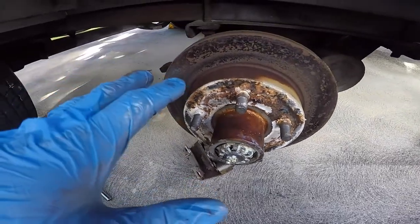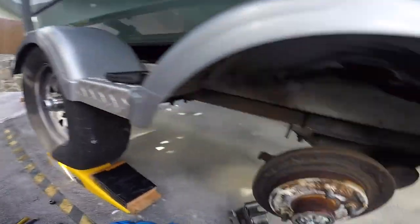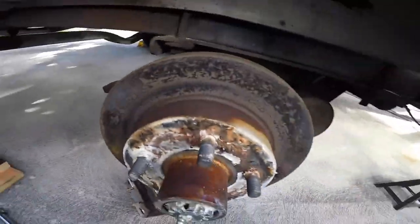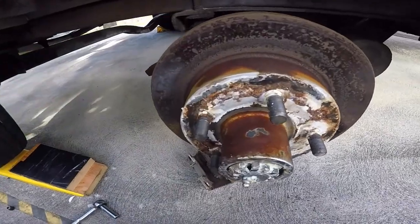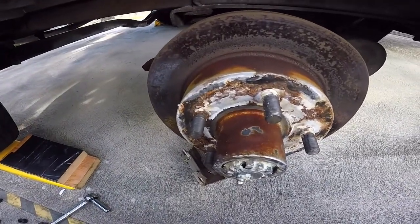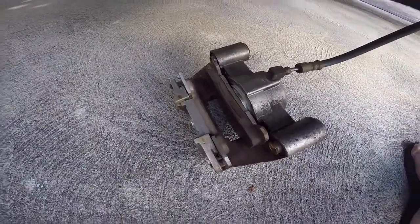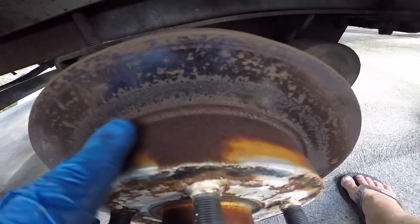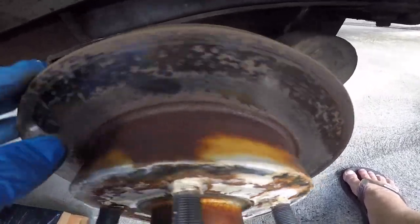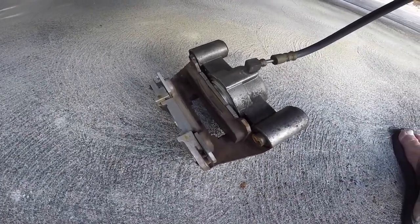Okay, so I did the rears. The rear is hub only. My front is brakes. So I took the caliper off already, and this is my rotor slash hub. To do these, it's basically the same thing. My brake set, I've got Kodiak stainless calipers, but the brake rotor hub isn't stainless. They call it Dacromet, but it still rusts. But the slide bolts and the calipers are stainless.